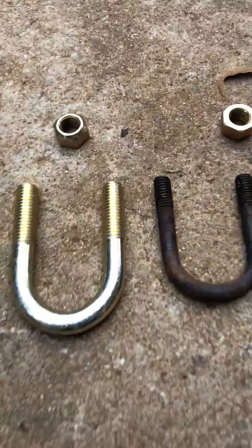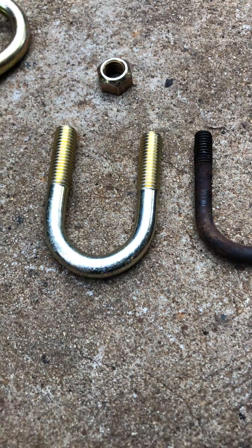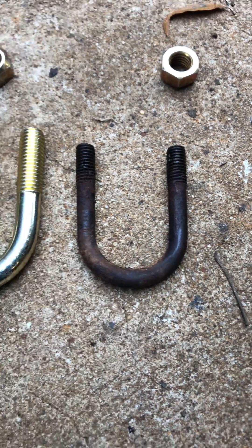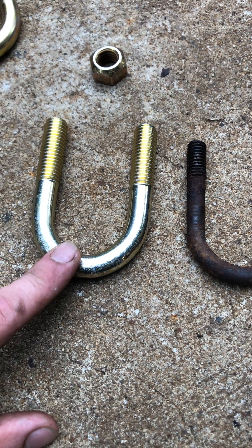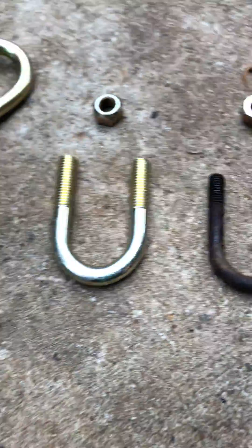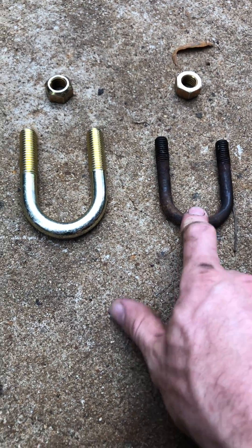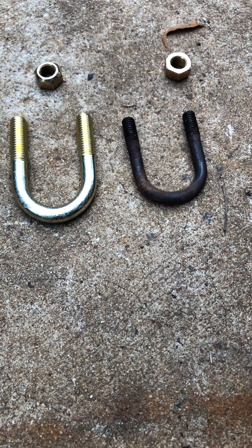I've got it up on jack stands. What I'm doing is replacing it with a later model version of the U-bolt — these are for like the '70s model years. Here's the original one from the '60s, and then on the second gen and up they started using thicker U-bolts. You'll notice the dimensions are effectively the same. The reason I'm doing this little upgrade is I've actually had a few of these snap on me already, which can be pretty dangerous. It's 50 years old and survived hundreds of thousands of bumps in the road.